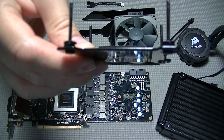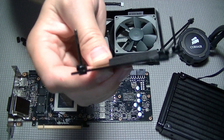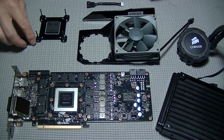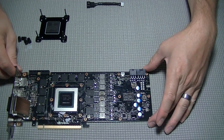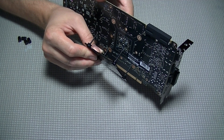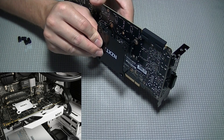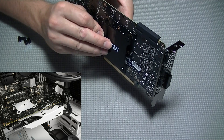The next thing to do, once you have all the screws, nuts, and washers installed, is to determine which way you want the bracket to face — this is only for cosmetic reasons. It depends on your case setup. I use the Cooler Master HAF XB EVO case, which allows my graphics card to stand straight up. Most cases will have the card lying face down towards the ground, which is why that first orientation is the most common and is referenced in the NZXT official installation guide. But for my particular installation, I will be flipping it in the complete opposite direction.